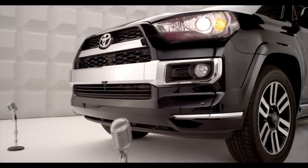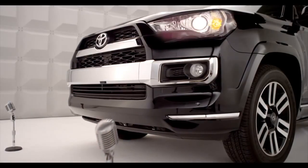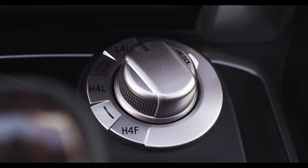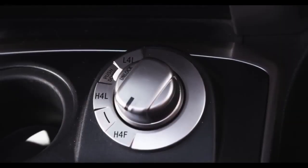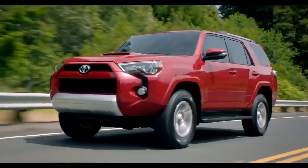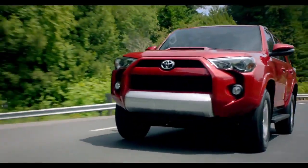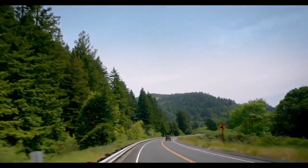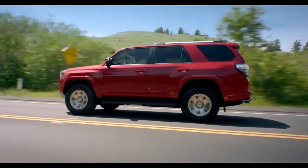Let's check out its chops. The drive modes on the 4-Wheel Drive Selector are H4F, H4L, or L4L. H4F is the full-time normal setting used for everyday driving on dry, paved roads when you want better fuel economy, a quieter ride, and reduced component wear on everyday roads.